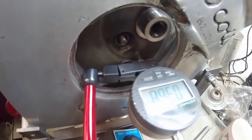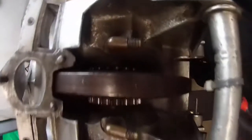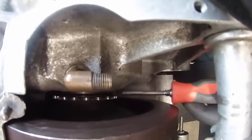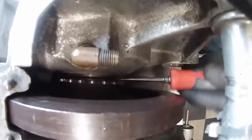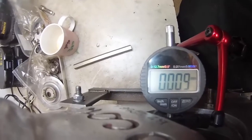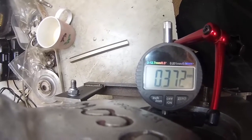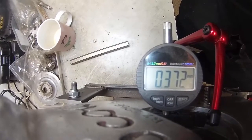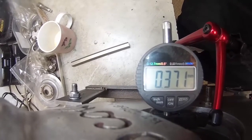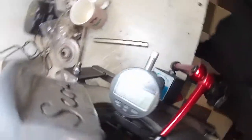This is our dial gauge up against the side of the engine. I'm going to go down gently with the screwdriver in between the main cups and just gently ease that across all the way one way. Going across to our dial gauge - and I'll go into the other side and gently lever that across. This engine is at 0.37 millimetres on the end float, which is just a tiny bit over 14 thou. So that will do very nicely. We'll double check those measurements and then deal with the crank bolt.